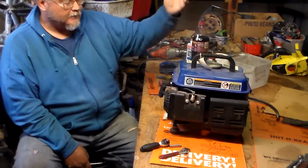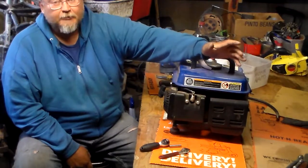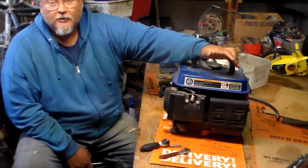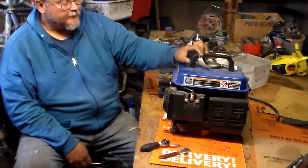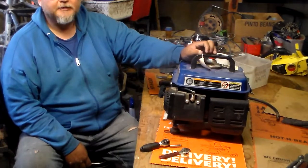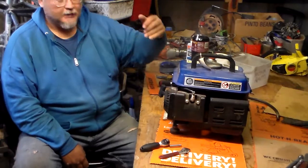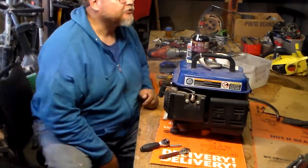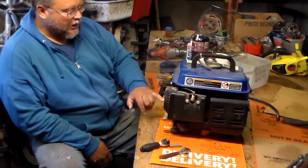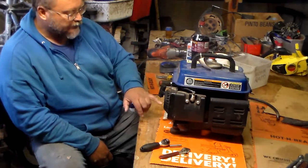And if you try it on weed eaters and chainsaws, two strokes burn up real quick if you're working really hard. It's better to run these two strokes at 32 to 1 gas and oil mix, because that has enough oil to lubricate the internal parts of the combustion chamber. Okay, so this is a 2 horsepower Chicago Electric 800 to 900 watt portable generator.